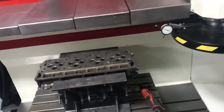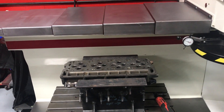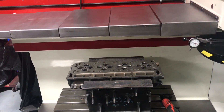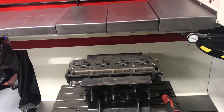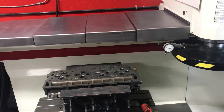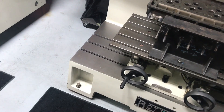I'm going to put it up and check it, just do a thin skim. They're already about 8 thousandths short, so we might wind up getting shorter push tubes. We'll possibly leave all the stem heights and spring pockets the same — we can just barely touch it. Depending on how much the other head takes to clean up, we'll decide how short we go.